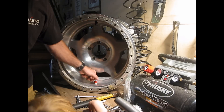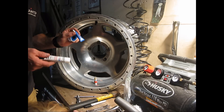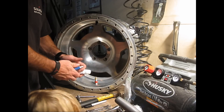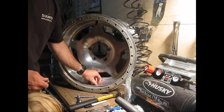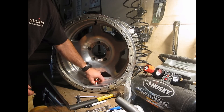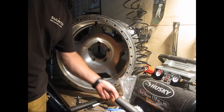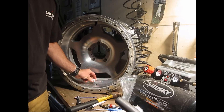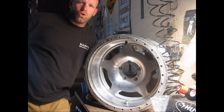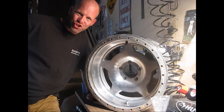I tapped it just a little bit further. I've got some Teflon tape on it — you might also use thread locker. I'd go with the red one if you never plan on taking it out again, the blue maybe if you do, or pipe thread compound will do the job too. When these valves come, they already have a little bit of locker on them, so that would work. I suggest using one for your tester and then putting fresh thread tape on before you get going. I'm also going to take these down to the local shop to get them powder coated, so I'll pull it out and put a small bolt in the hole so they can powder coat around it. That's the whole process, start to finish. I hope you enjoyed the video — find more answers at jk-adventure.com. Have a great day.